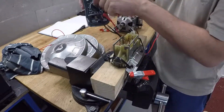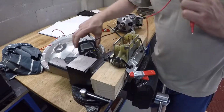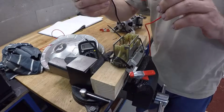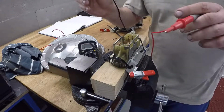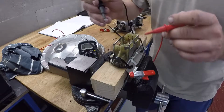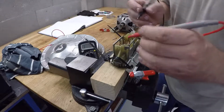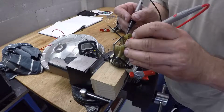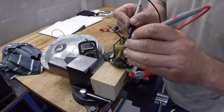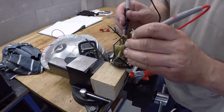But check this, when I turn this to resistance, my friend told me that when there is no connection, the resistance is of course very high, and when these pins are connected, the resistance should be almost 0. So first, if I put this and this pin, because these are connected, you can see the resistance is 1.0 or 0.9. Then I change the pins to this one.